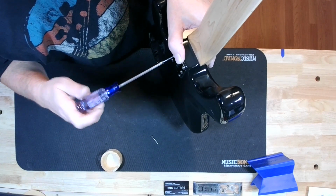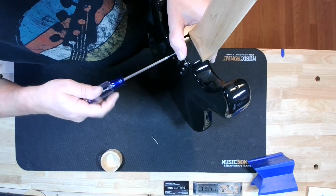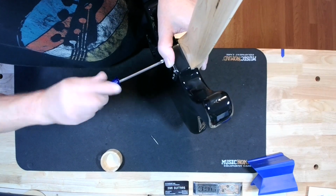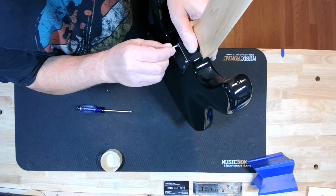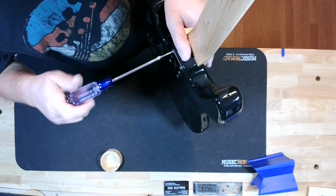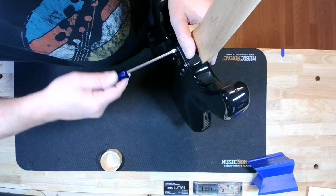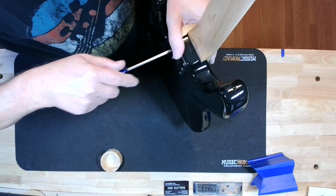You especially don't want the neck bolt to give you trouble going into the body part of the hole. It should pretty much go through there easily, if not straight through to the neck. Because if it starts hanging up in the body and then tries to draw up into the neck, you're going to have a gap over here, and that's not going to be fun, and it's coming apart again, and you got to drill out the body holes. So far, so good. This guitar will probably look better than it ever did when it was new. I say so my damn self.